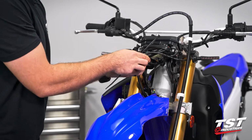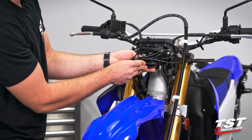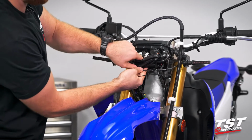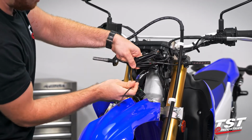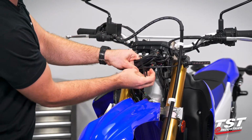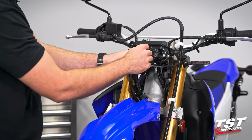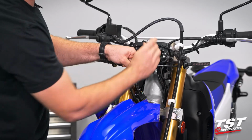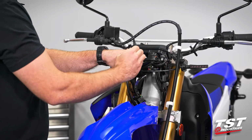and then I'm actually going to opt, there's kind of a wire loom hanging down from the gauge cluster. I'm going to tuck my little pack of wires into that, grab them all with my hand, making sure I'm leaving the headlight loose because we need to plug that back in. Now with all of them bundled in my fingers, I'm throwing one zip tie back over all of them. Make sure your wire sheaths are still kind of in the correct place, just covering that plug.